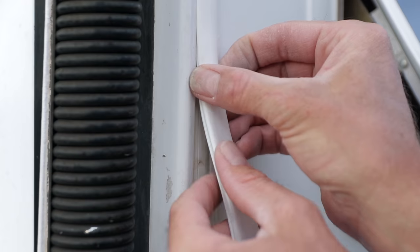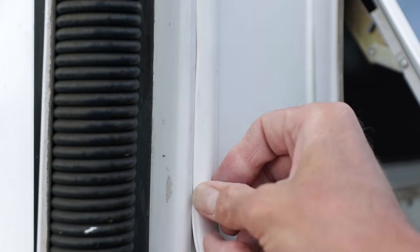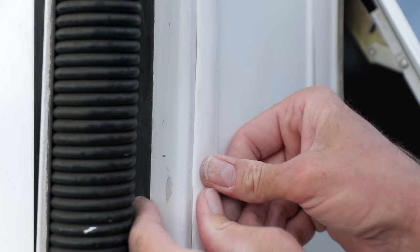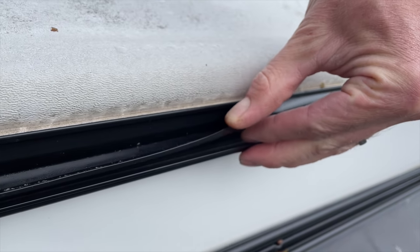As that water hits it, it would have to go up and over in a U-shape on the top, and on the bottom it already sheds it off, so we can get that water to go out rather than inside that trim piece. Because what happens is that water runs along there, finds a screw hole, rusts it out, finds a way in, and starts to delaminate your RV — and that is going to shorten the life of your RV. This is really industry-wide; a lot of different manufacturers use this type of construction between the roof and the sidewall, and there's really not a whole lot of attention given there, but I think it's a very vulnerable area. I wish this would change in RV construction, but I don't see it changing anytime soon.